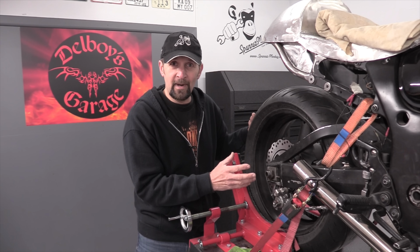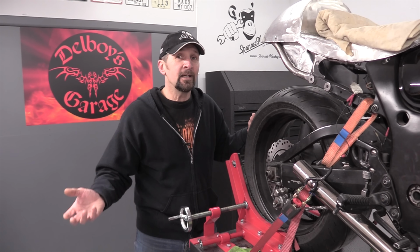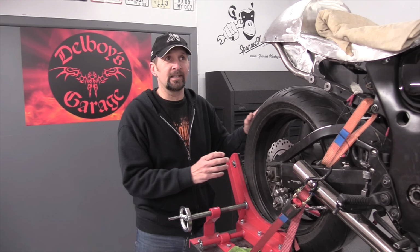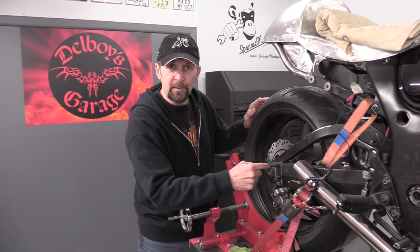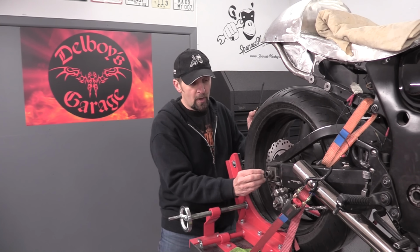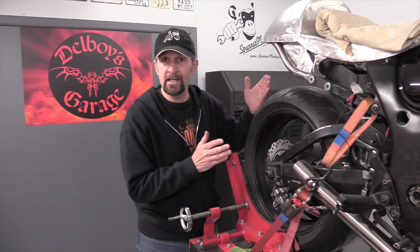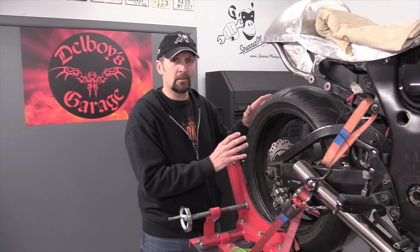So I'm not going to talk to you about how to check your rear wheel alignment. You know how to do that. It's very simple. I've got videos on it if you're stuck, but check your rear wheel alignment and get that absolutely bang on. And when it's something significant like this and you're trying to diagnose why your bars are twisted, well, don't just rely on the stamped marks on the swinging arm. Get yourself a caliper. Actually check the distance of the blocks from the back of the swing arm, find an accurate point of measure and do a really accurate measurement of your rear wheel alignment. If necessary, get a laser liner and align it along the top of the chain, whatever works for you best, but do that rear wheel alignment.